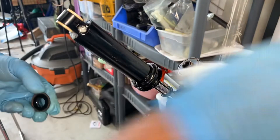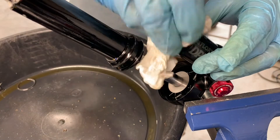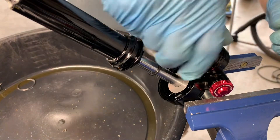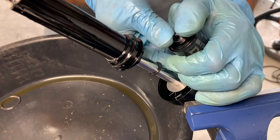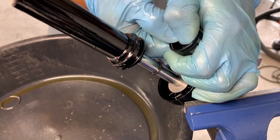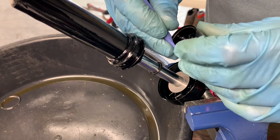As with all suspension, I clean as I go. I don't want any dirt in my work area. After thoroughly cleaning the interface, it's time to slowly and gently depress the piggyback cap — or the IFP — back and remove the retaining clip.